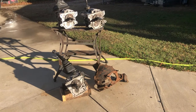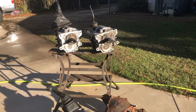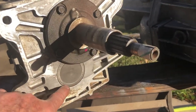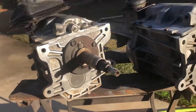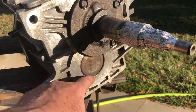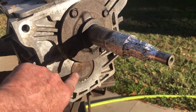The bottom one is a world-class 1995 S10 transmission. The top left is a 1993 world-class T5 transmission with a Muncie bolt pattern, and you'll see the bearing cup right here has a smooth edge and it says Timken on it. That smooth edge, where it's sort of flush with the case, indicates that it's a world-class, whereas this one here has a little edge where you could stick the edge of a screwdriver in and run it all the way around. That's a non-world-class — if it has that cup, it's non-world-class.